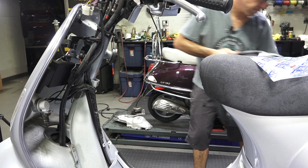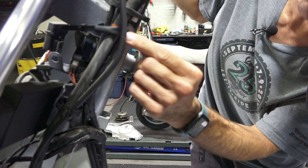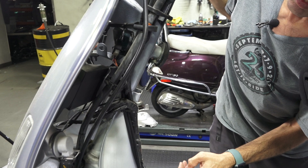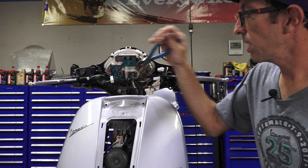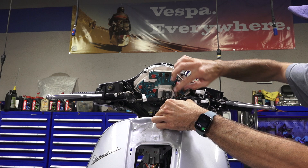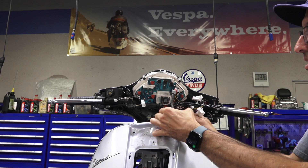So you have the speedometer cable going right through this clamp — or sometimes it'll go through a zip tie, depending on the model. It is possible to pull it right through, but I'm going to release that little clamp. I've seen so many people change their speedometer cables completely misrouted — the problem is you'll end up breaking the cable prematurely. First you've got to disconnect the speedometer cable from the speedometer. Just use the wrench and loosen it a little bit — some have a nut, some have a knurled fitting. That's how it disconnects from the speedometer, and now the cable is free.